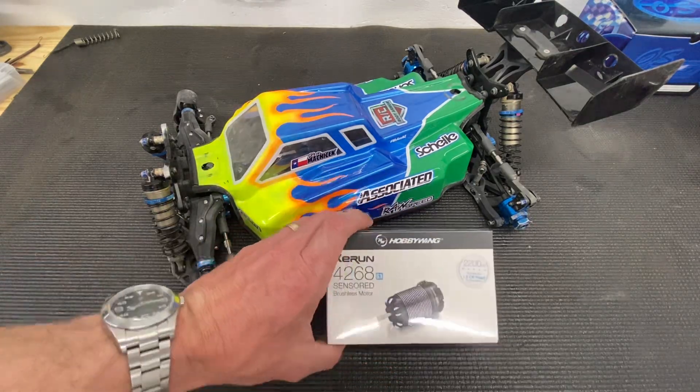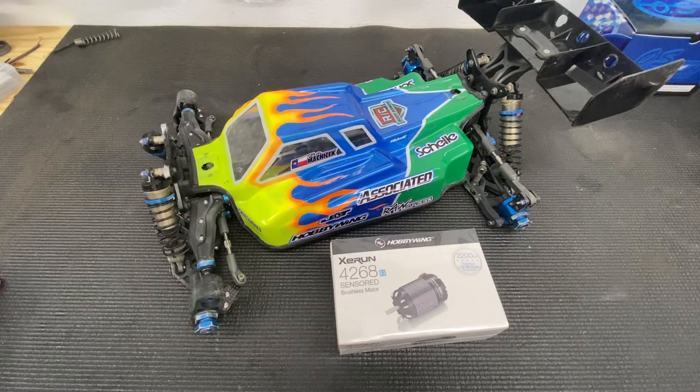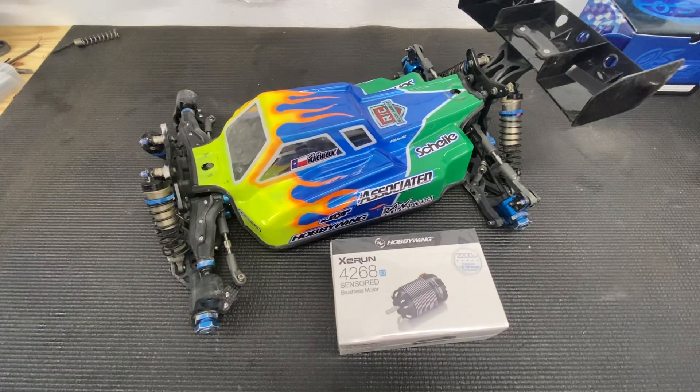This is a Gen 3 Hobbywing 2200. What I've been finding and talking to people about is they're using the 2200 — they're either turning it down or driving more conservatively, and they're able to run the car more efficiently with more battery left than having to run the 1900 completely tacked out. Or they're using the extra power to get harder starts out of corners, into bigger jumps, or higher speed on the straight, while still having all the smoothness and control of a 1900 in the 2200, because you're still getting that great Hobbywing full-sensored experience. It's still going to be smooth, still going to have great power, just going to have more legs.